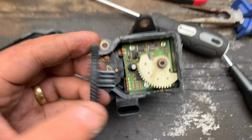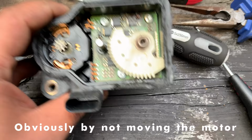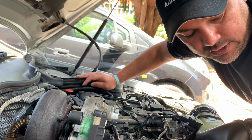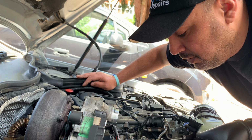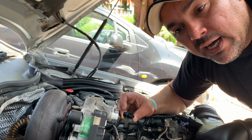That transistor there was probably, you know, affecting the position of the motor itself, and it failed. Yeah, if you have come across this problem before, you're probably aware that a lot of people bypass this system or put a 4.7K resistor between power and signal. So that's what I'm going to do today,